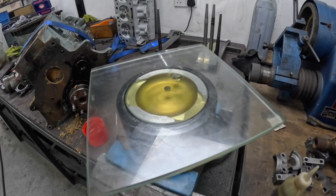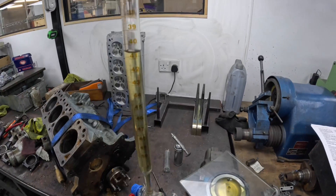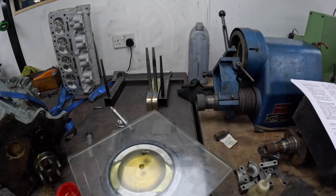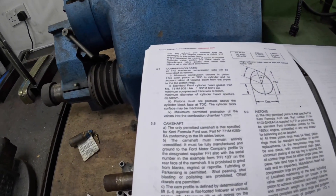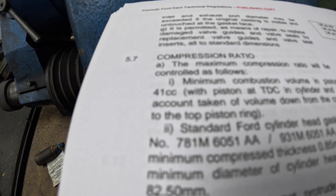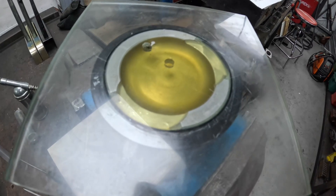So I've machined this one piston a couple of times just to get my depth right and we're really close now - we're at 40.6, or 40.5 maybe. But it's got to be 41 in the rules - just can't see it actually - there - minimum combustion chamber 41cc. So we're going to have to get this on the mill again and just get these valve cutouts down a little bit more, and then hopefully one last check and we should be bang on 41.